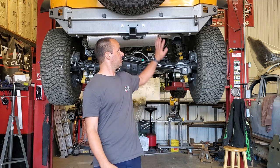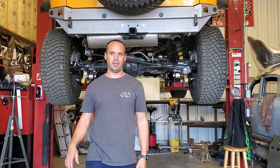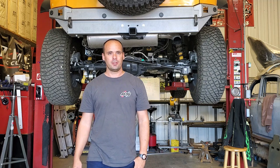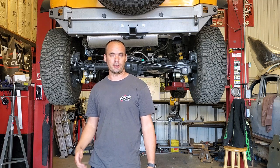It's been quite a while since I physically installed the sway bar. I've been driving it and it's just been acting like a stock sway bar, except more expensive. So now I'm going to get started on the wiring. The sway bar comes with a small wiring harness section that links together the sensors as well as the solenoids, and kind of runs across the crossmember. It's really nice — it has little clips so it'll snap into the crossmember on the frame. And then it's got a large connector at the end which also snaps into a spot on the frame.